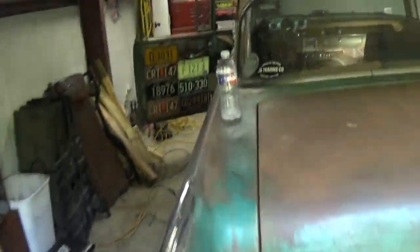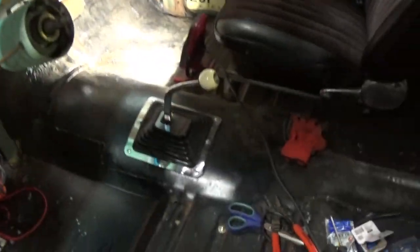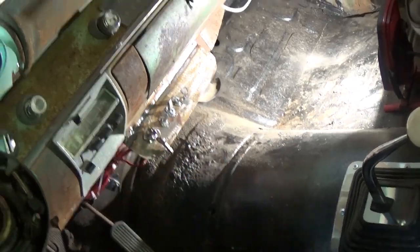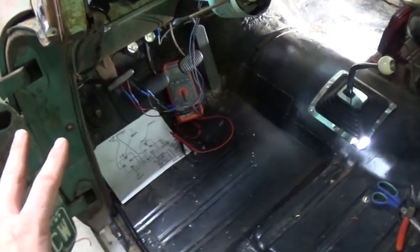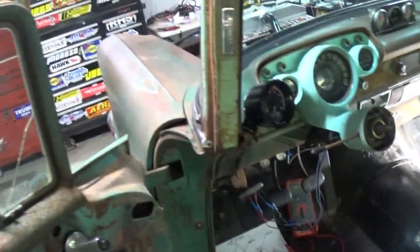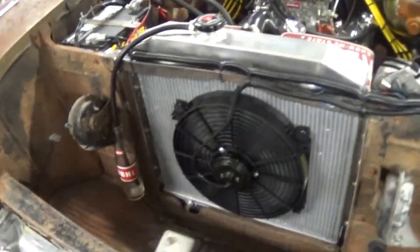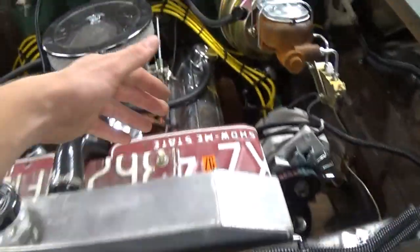As you can see, I got the four ways working. Well actually it's just two ways now, I don't have front yet. I had that switch all messed up — I had it jumped over to the wrong terminal. So that's working. Everything's working. Now I can button up all this wiring for the column, make it look nice. Got the fan wired up. As you can hear, got it all loomed up nice. That thing really moves some air. That should really help out quite a lot.